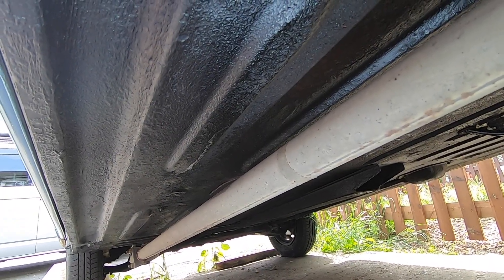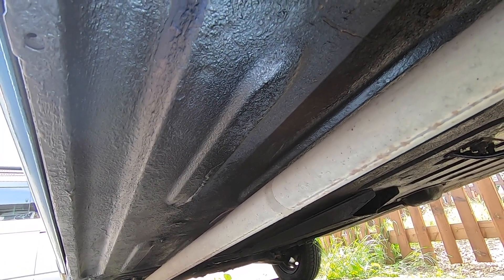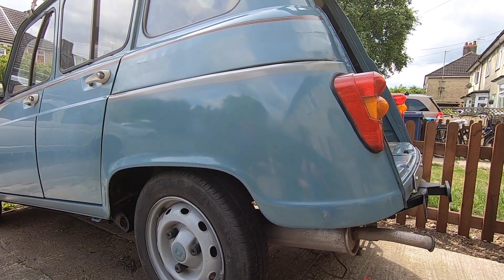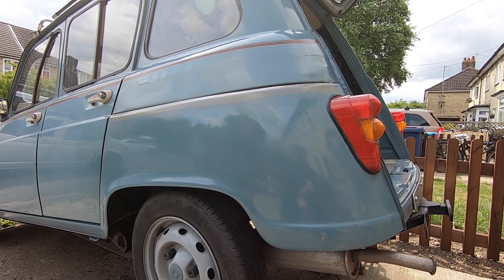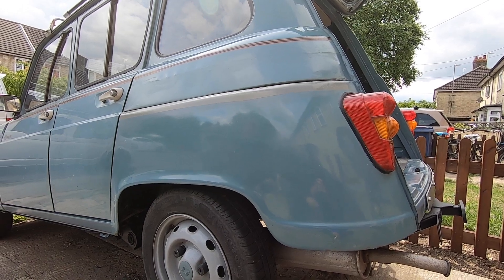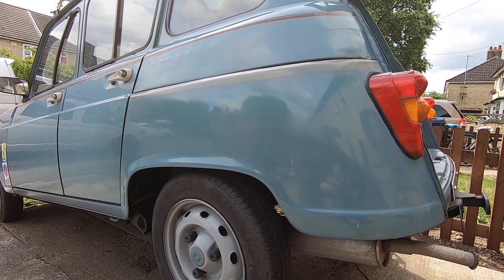With the car up on the ramps I've been able to get underneath and scrape off the old underbody sealant and replace it, which should keep that looking good and being looked after for the next couple of years at least. I've had this wing off the car to have a look underneath at the upper wing repair that I did - that all seems to be holding up okay. I've just cleaned that back a little and put some seam sealer in there to make sure no water leaks into the car from the top of the wing. I also managed to clean off quite a lot of the mud and road grit from the inside of the inner wing and give that another coat of underbody sealant.